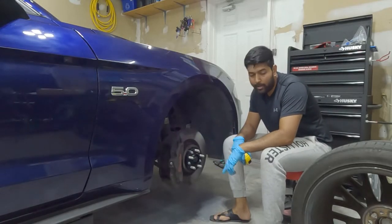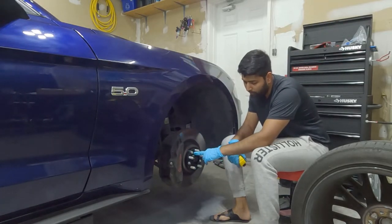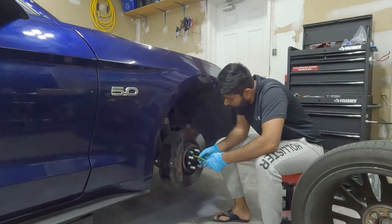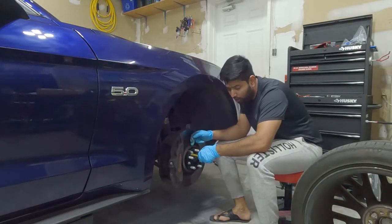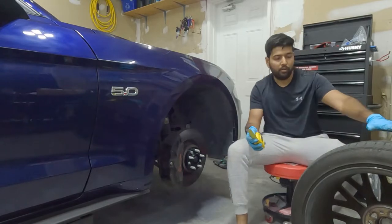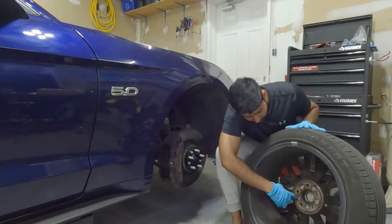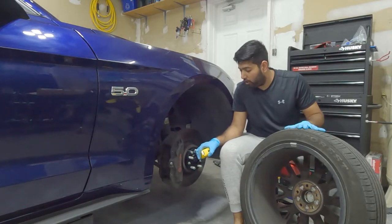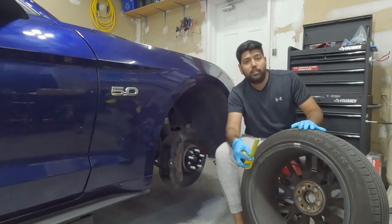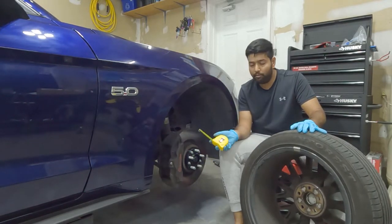So guys, finally our wheel spacer is installed. Our factory lug is a little bit longer than the surface of the wheel spacer. So I'm going to use a measuring tape to measure how many mm it's longer than the surface. It's about 3 mm longer. And on these factory PP1 package wheels, there are some notches on the wheel. That's perfect for those lug nuts, and the notch is way bigger than the leftover lug. So we can put this wheel on the wheel spacer.